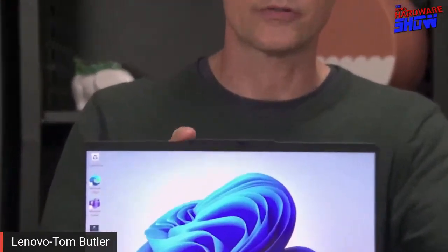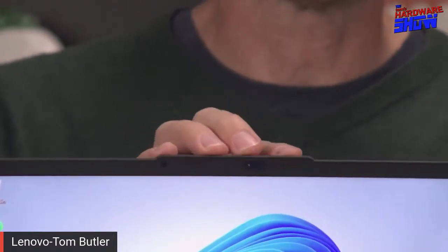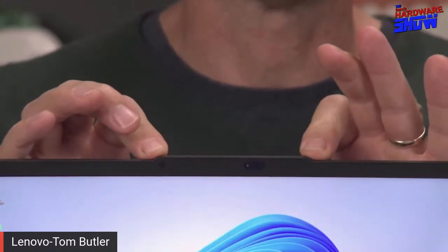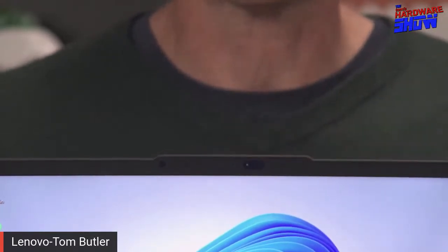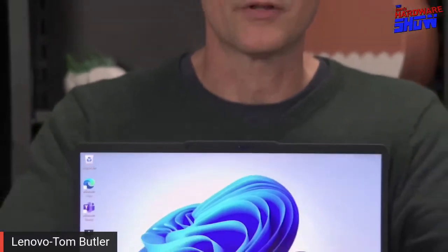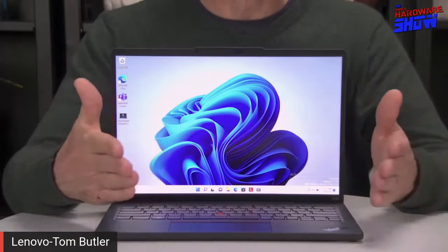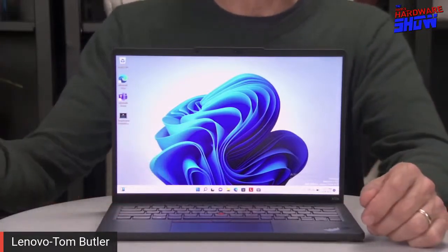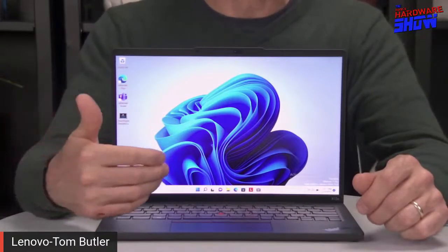The other thing I should highlight is every one of our devices has been focused really on collaboration. So you're going to see a little bit of a rise here. I've noticed that, yes. We affectionately call this a communication bar, and it houses a 5 megapixel MIPI based camera. One of the advantages we have in working with Qualcomm is taking advantage of their mobile phone expertise and experience. So we've got a very high quality camera, but we also have the AI engine underneath that offloads from CPU based compute to render out auto framing and background blur. It will actually sense presence of you walking in front of your device, and if you look away or walk away, it will dim the screen. Obviously, I have it turned off today, so it stays on. But from a power savings perspective, you'll benefit from that as well.